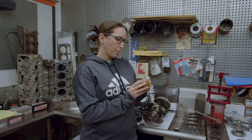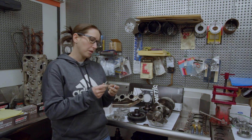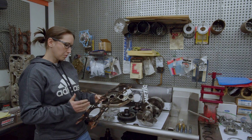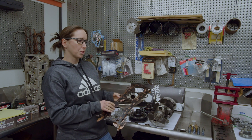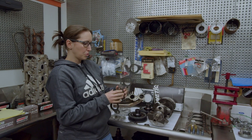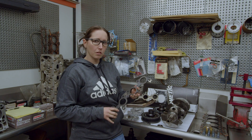The other thing you typically do is check all your plugs — I'll have a whole episode about reading spark plugs. Pull your plugs out, make sure there's nothing dangerous on them. I always look at all my gaskets to make sure there's no leaks. When you pull the heads off, check the head gaskets to make sure they weren't starting to lift. I also check the exhaust gaskets — a bad exhaust leak will show up in your data and will mess up your tune.